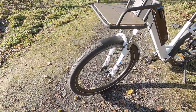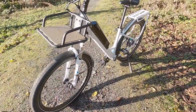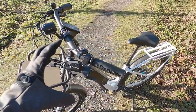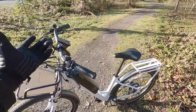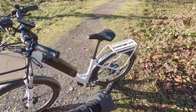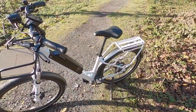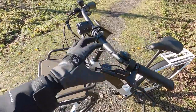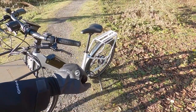I do really like the performance of this thing, and hydraulic disc brakes with 180 millimeter rotors, dual piston calipers, brake levers with adjustable reach. Hydraulic just means you don't have to squeeze quite as hard, especially for the rear brake, because if these were mechanical brakes, that rear brake line has to travel farther and can kind of get gunged up over time. I'm a big fan of hydraulic, and these ones are excellent because they have motor inhibitors built in, meaning it overrides the motor, so you're not fighting against the bike at any time.